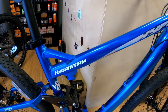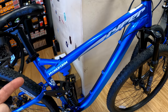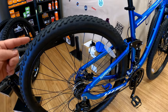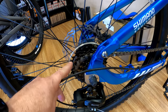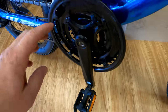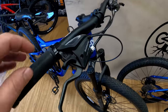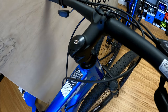Hyper Hydroform — Hydroform is actually a way of shaping the frame. They also called it ultra lightweight, which I'll talk about the weight in a bit. It is far from lightweight. Going over the specs: you have 29-inch wheels, no-name tires, Shimano 7-speed, a freewheel, 7-speed Tourney derailleur, 3-speed front derailleur, very cheap pedals, and a big spring shock. Up front you have HPR suspension, and here you have your 3-speed shifters — so this is a 21-speed. At least you have a threadless steer tube, which is not bad.